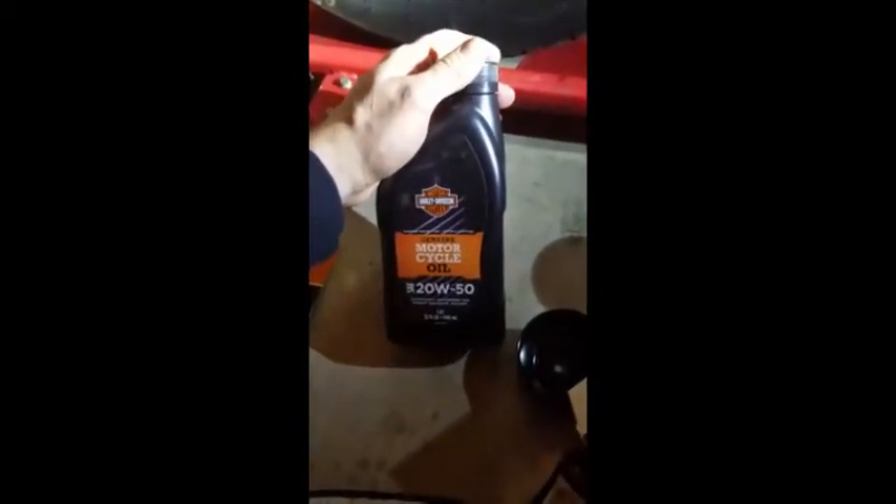Now that I've got my oil filter out, I selected Harley-Davidson's Genuine Motor Oil 20 weight 50, which is generally recommended. You can go with heavier weights if you have a higher mileage bike, or if you live in different climates where it's warmer or colder. I'm going to go ahead and put about four ounces into the filter itself, let it come up over the top, and move the oil around to get it into the seal. You don't need to worry about the oil spilling out — as long as you keep spinning it when installing, you won't have any issue. Also, don't forget to clean up the area where the seal meets the casing.